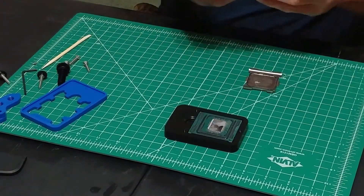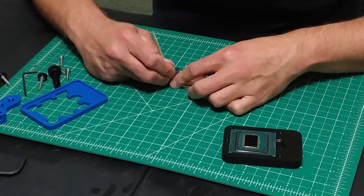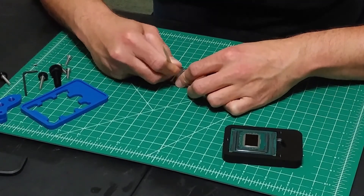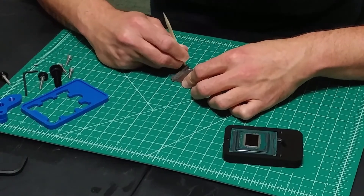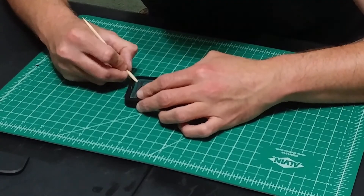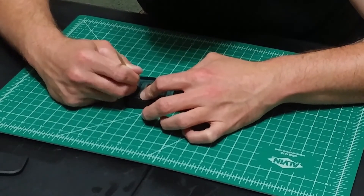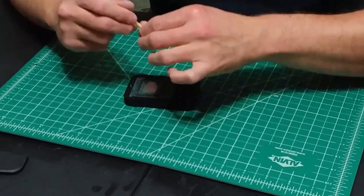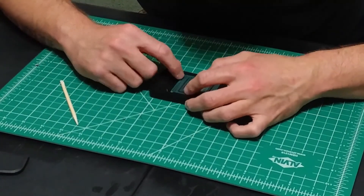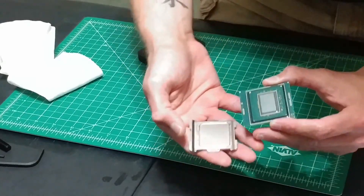From here, clean off the old crusty thermal paste. For the next part you'll need to remove the old sealant from the IHS and PCB. The Rocket 99 kit comes with a wooden tool for this. For my CPU this was a painstaking process that involved a lot of back and forth. I used the flat end of the tool to peel up some of the sealant and then used it almost like an eraser, then used the pointed side to detail. I suggest starting with the IHS to familiarize yourself with the process and then moving to the CPU. Be very careful around the resistors and capacitors on your CPU — you don't want to break these off. Expect to spend at least 30 minutes, maybe even an hour, cleaning the CPU.